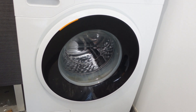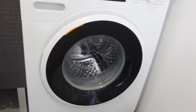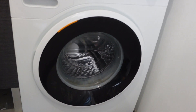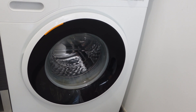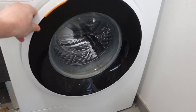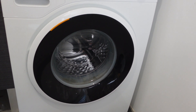Then you're going to wait for at least a minute — any longer is better. Once that minute is up, you can restore power, and when you do, you're going to do a cycle of openings and closings of the door. Most models it will be open and close six times, and that will signal to the machine to reset.